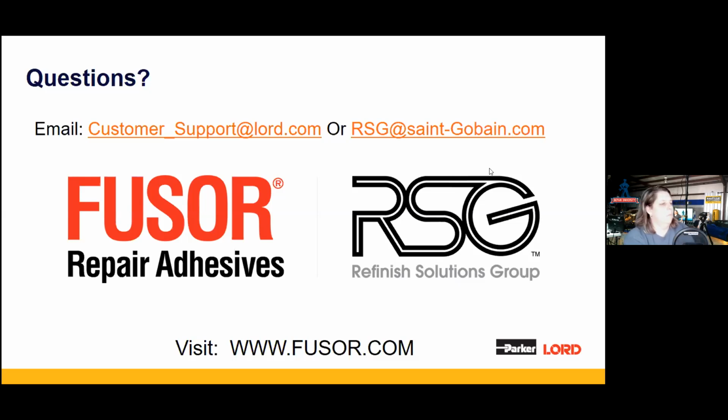If it's just a seam sealer, it's laying on top of a seam, obviously it's not an adhesive, right? But if you got that question, what's between a panel, is it adhesive or did they do a weld sealing operation? And it's really hard, yet there's no OE documentation, what are you going to do? You're probably going to lean toward putting an adhesive in there. Generally, when we're talking seam sealing, it's laid over a seam, with the exception of the rear areas of a car, where you start to get some gapping in the panels. That's where they'll generally use expandable seam sealers between the panels, and those are real fluffy because you're just trying to control airflow and water intrusion. It's a tough question to answer 100%.